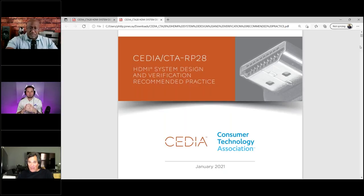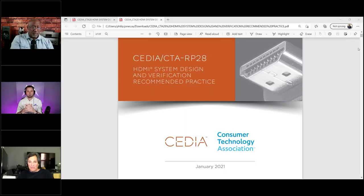And one of the things we looked at a long time ago was HDMI cables used to have a little wall wart. You take the end of the HDMI cable, plug it into a little power supply, plug it into the wall. You're not going to need that anymore, because now there's power in the HDMI and there's a spec for it in 2.1. So these were band-aids. We stuck in systems to make sure the cable had power, because that 5 volts we were looking for, that you talked about before, we're looking for 5, we've got 2.2. And, you know, I'm looking for 5 and now I've got no picture. I know why, so you plug it into the wall. That can't stand. That's got to go away.